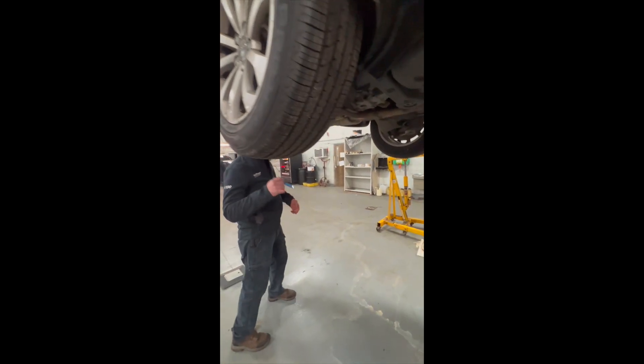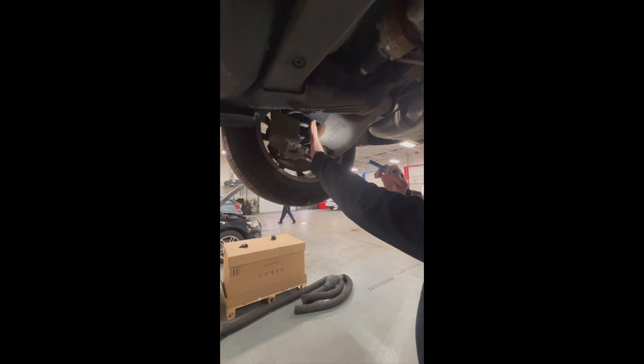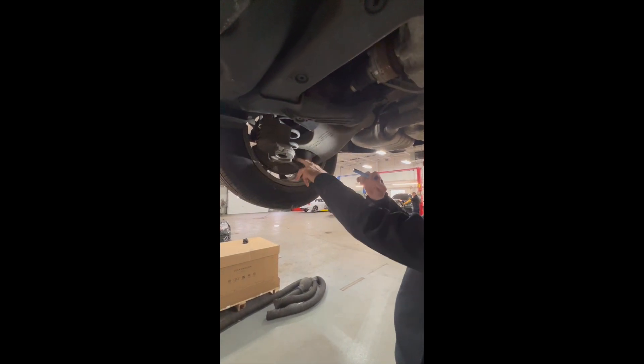I have my flashlight with me here and we're starting with the rear suspension. Here's a standard rear spring, sometimes replaced with an air adjustable type spring. This is a control arm here — it pivots here, here, and here. All of these are wear points.